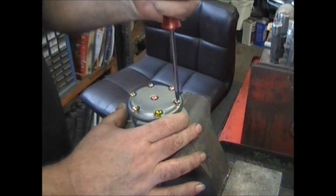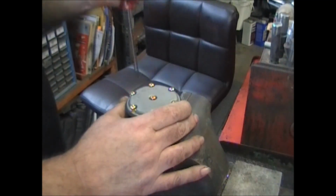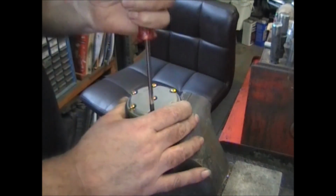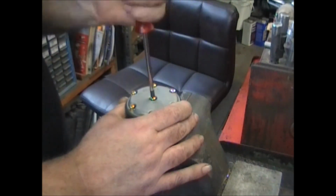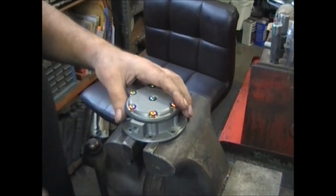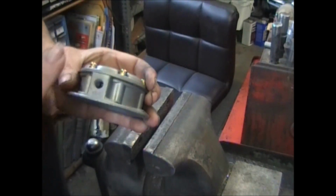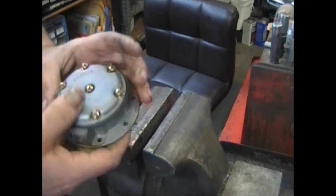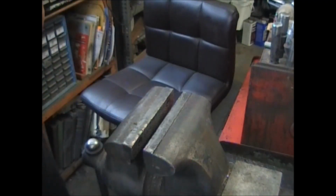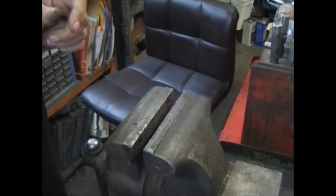These foreign pumps, the aluminum in them is a lot more stable than, say, the ACs. Now we want to test it, kind of a half-ass way of testing it. You should be able to suck air out and not blow it in. Same thing with the inlet, you should be able to blow air in and not be able to suck it out. That was the noise of success.